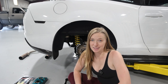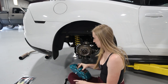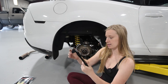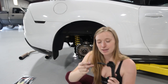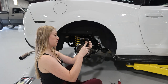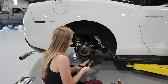All right, now we're on the rear brake setup, and I got everything put together along with the little nipple for the brake lines. So first, just need to put on the rear bracket, and I put two shims on here before we slide it on. And then it came with these little 12 point nuts, and we're gonna tighten it on the back. These kind of sit tight, so you do have to snug it on really well. For the bracket, we do have to put a shim before you put the caliper bolt all the way through. The shim should be against the surface of your hub.